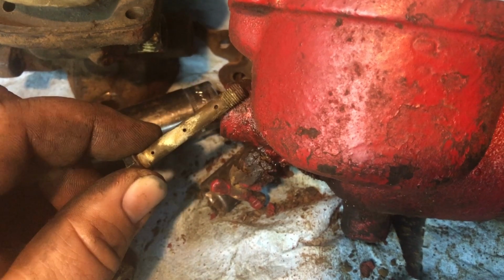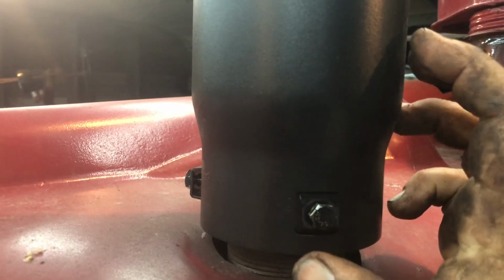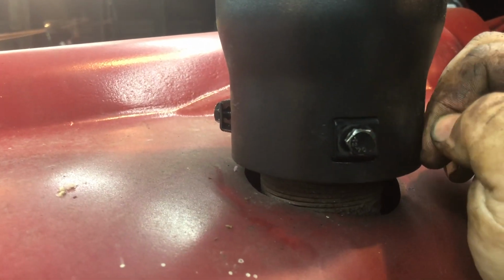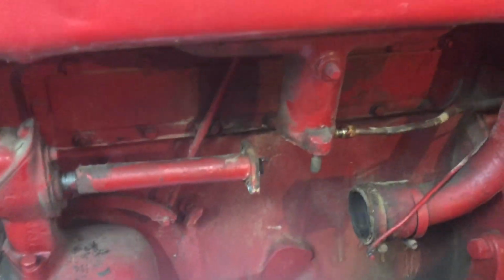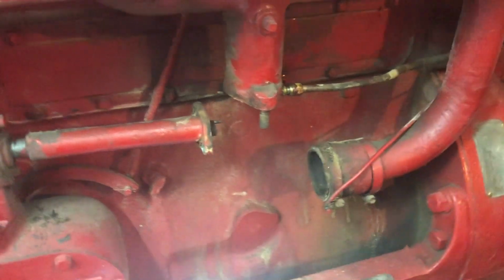This is just me again stabbing in the dark. Here, I'll come and show you what I think. There's a possibility. I'm tripping over stuff. So now with this new exhaust pipe, the way this is bolted on, this is just some truck stud. And I'm thinking there's a chance that some of the exhaust gases, instead of just going straight out, because it's just clamped around it, might be coming out, and especially when you're going down the road, it's getting pushed back down and heating it up. Maybe it's vapor locking, but I just don't think it was running like that. This was really warm, but it's also connected to the exhaust manifold, so that's the kind of sucky deal. So I'm going to get a kit ordered.